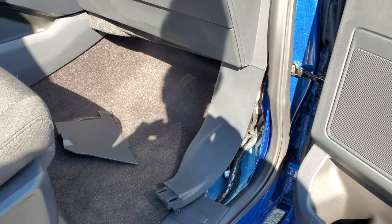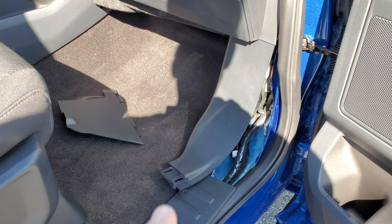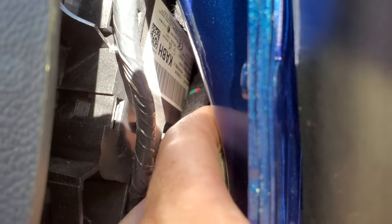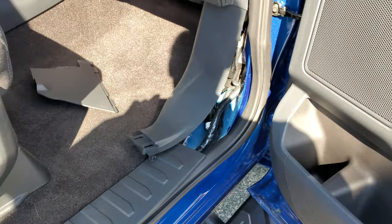Once you get everything disassembled it's going to look a lot like this. All you're going to want to do is take a look on the back of that box right there — that is your body control module. It has a sticker printed on it and that's going to have your door code. When you open this up there's foam — push that back, push that cord back, and you're going to see right up there it says key code: 71057. That is the factory code for this truck, and it will be with this truck forever.